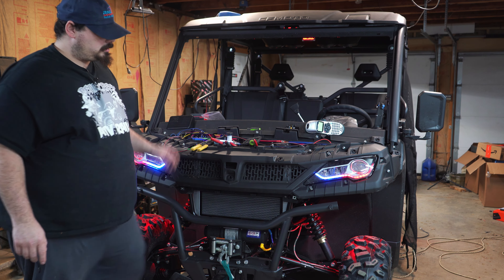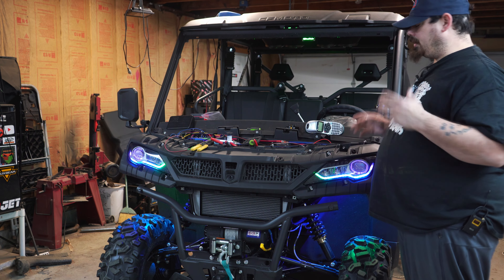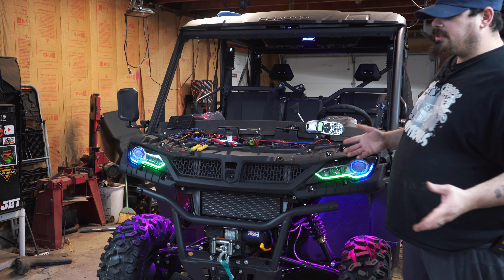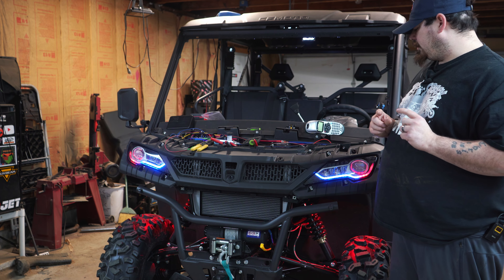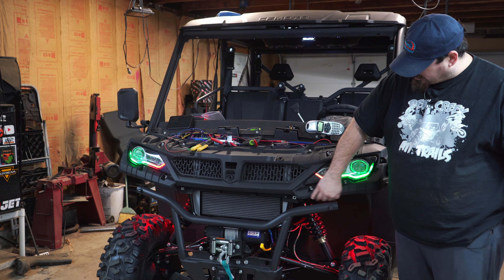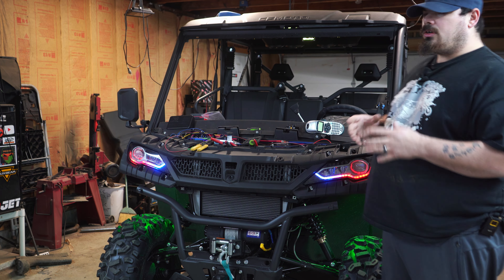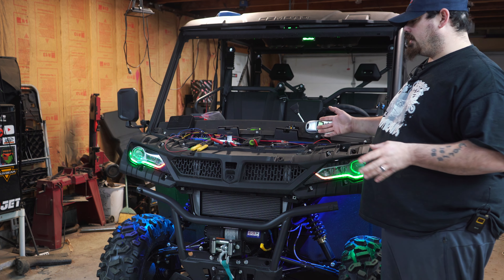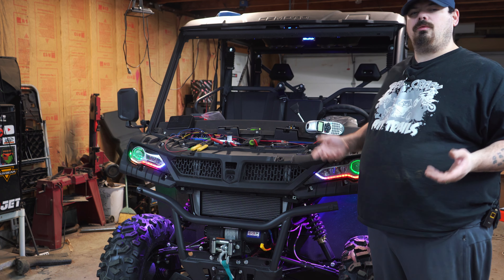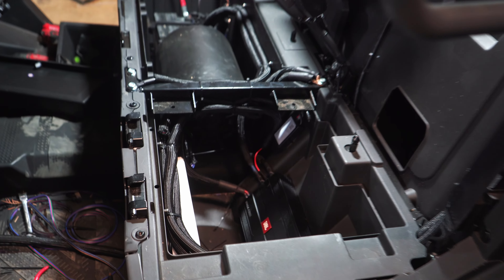So that's how you do that. We got the horn hooked up and working, and the front turn signals. You guys can use the little round lights — we've had mounts that went under here. You can hook any LED you want for a front and rear turn signal. I just showed you the wires you're going to need to do it, and it's super easy.